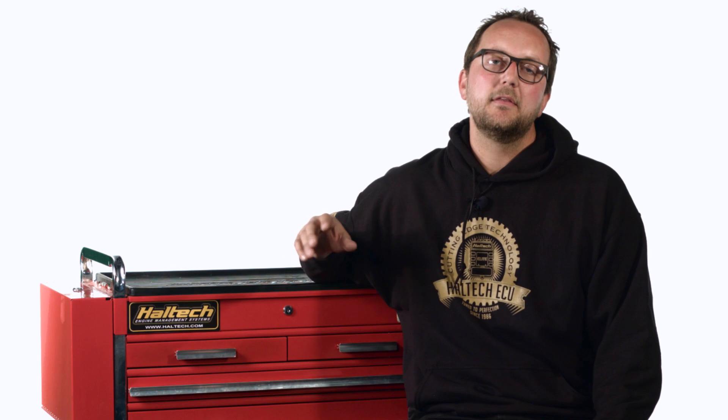Well Ryan, I would be using the Elite Series ECU because it's got a bunch of advanced features over the Sport range. The reason why the Elite is going to be a lot better for your Nissan four-cylinder SR20 is all the long-term learning features. So the more you drive the car, the better your fuel tune, your knock control, your boost control and your idle control is going to get, because it's always doing a long-term learning function in the background to meet all the targets that the tuner sets.